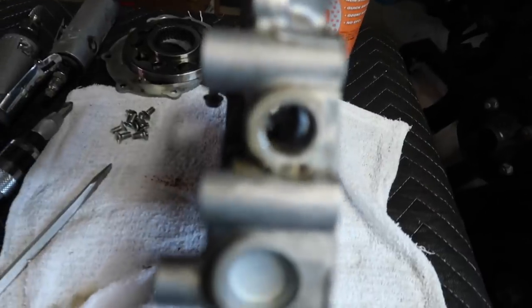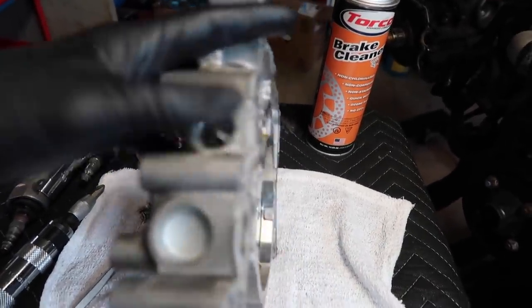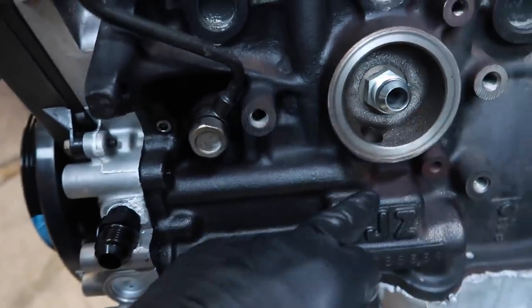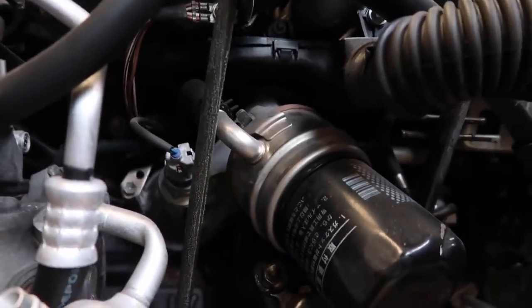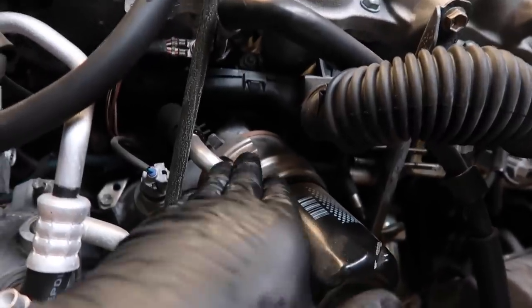Take a look down here — that's where the oil could come out, but Toyota doesn't do that. They have a port right here blocked with pipe thread and they tell the oil to go out this way, turn a 90, and leave there. That 90 runs right here on the block, then does basically another 90 into your oil filter, into your OEM cooler, and then up into your filter. So it has a lot to travel before it makes it to the motor — a lot of tight passageways with 90-degree turns that slow it down, and each thing adds more restriction.